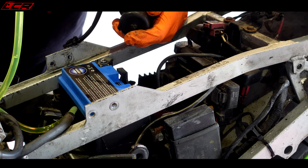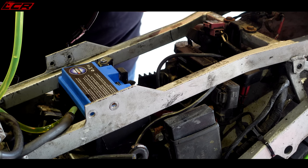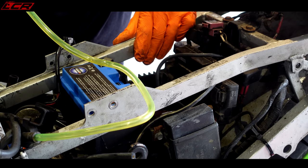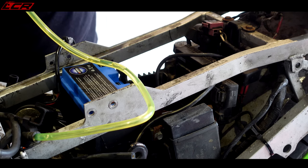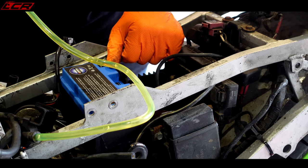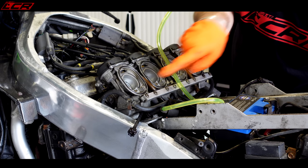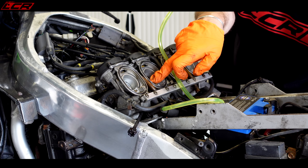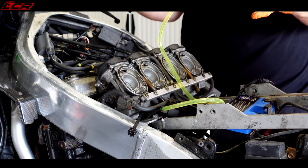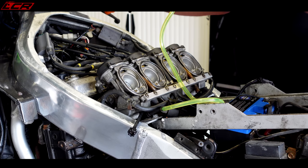Pump is doing something - I can feel it vibrating in my hand. Obviously you can't hear it with the engine, but I can feel it going. That pump is doing something - it's sucking that fuel in now. I don't think that was doing anything before - it's just started working since I've been messing about with it. Maybe it's freed up. So there's no fuel in number two or number three carb. We've definitely got a blockage or there's no fuel getting through to that carb. But it should still sort of fire on three hopefully. So I'm going to get a little bit of choke and turn it on again.